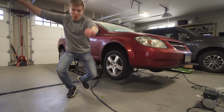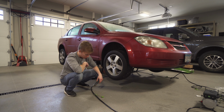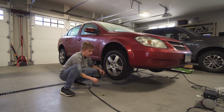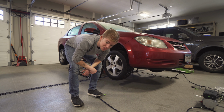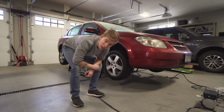And with that, we've got our QuickJack all set up. Be sure to check all of the fixtures. If you see any red fluid, that means you didn't crank it down enough and it's leaking a little bit. You might have to adjust your Teflon tape a little bit.